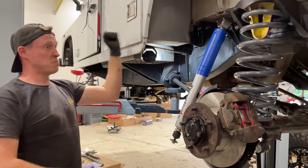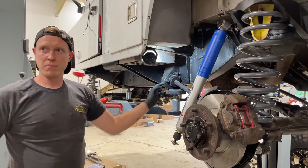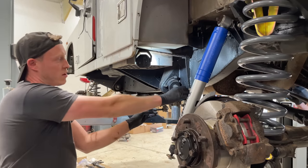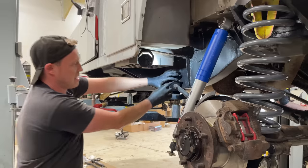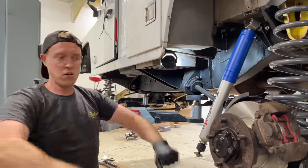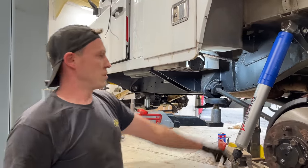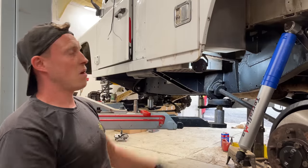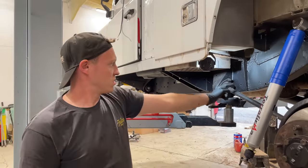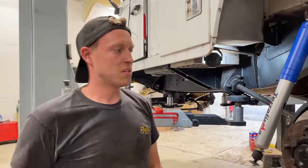You can imagine with a 2-inch lift, this is a big heavy vehicle. If you put a trailer on the back, those bushes are not going to last, because it's going to be trying to squirm all over the place as it's trying to keep the axle rigid. So the idea with the cranked rear trailing arm on a stronger bush is to basically keep this shape of the arm, the bush pressed into the chassis, all the bushes being used and utilised, so that the vehicle can stay stabilised along with the upgraded bush. So definitely need to do it with a 2-inch lift, especially on one of this size and weight, with that thickened chassis. It's a must with these, because you can just see, it wouldn't go down the road too well the minute you put any weight in the vehicle, it would start squirming, and we want this vehicle to be riding really, really nice.